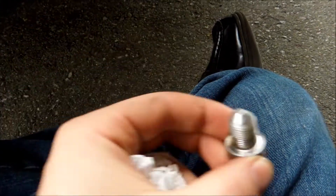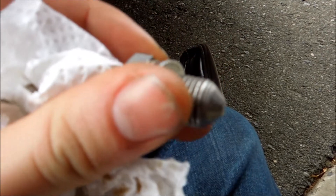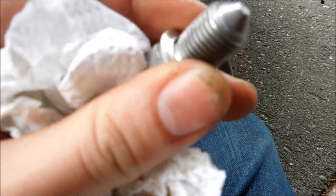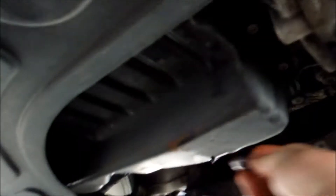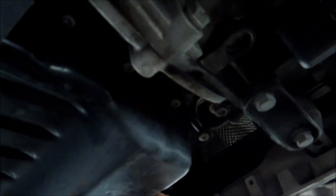With the filter removed, the next thing you want to do is take the drain bolt and clean up the threads with a paper towel. Inspect them — look for any grains of dirt inside. Mine look pretty good, so I'll leave them. Now go underneath the car and put the bolt back on the hole. Mine's still dripping a tiny bit, but that's fine. The bolt is on a bit of an angle, so match the angle and screw it back in.